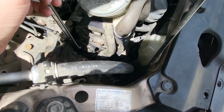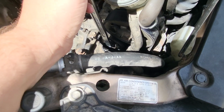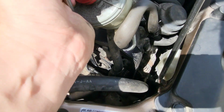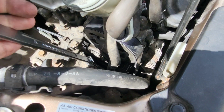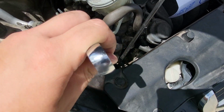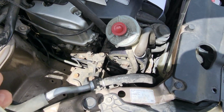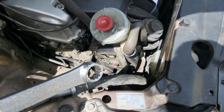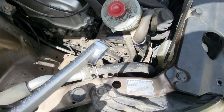It seats well onto the tensioner. If I can get it here, yeah, it's a 12-point box end wrench, and you just get it on there, and you're able to pull it over here, and it loosens up and you can sneak it off. Works fairly well, though. Like I said, if you can get something like this in a ratcheting wrench that sticks out, that would probably be your best option.